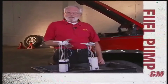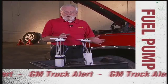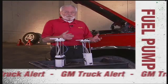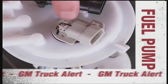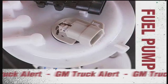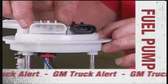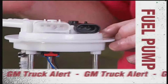Some late model GM vehicles are experiencing fuel pump problems that will either cause the vehicle not to run at all or just run intermittently. This is because of a problem in the electrical connector — the pins are very small and because of vibration they move around and get hot. This actually causes the plastic to melt in the connector, as you can see here, resulting in a loose connection. The folks at AirTex have solved this problem by using a big GM style connector with big beefy connectors that won't get hot and won't move around.